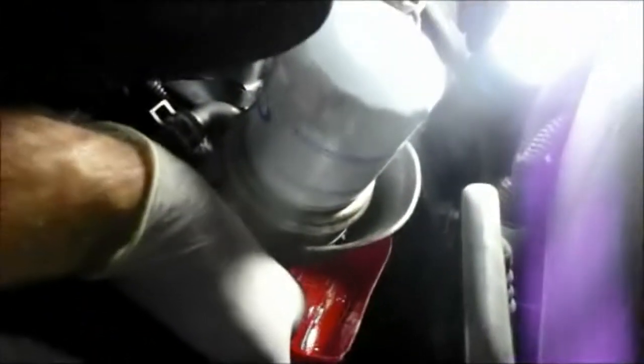This is where the filter is located, and down on the very bottom over here there's a very small hole that we drain the oil into a little container. Underneath the bottom you see that little drain hole right down inside there — when you take this filter off the oil is going to run down into here and drip out. There's a little tiny cap like this you take off, and what I always do is cut down an oil container like this and hold it underneath the bottom right here, then you take that filter off.